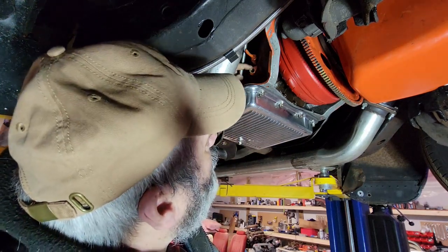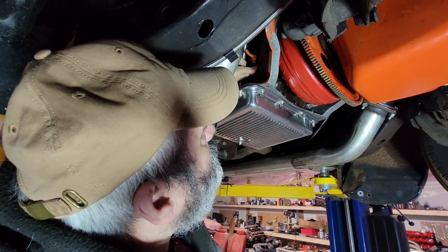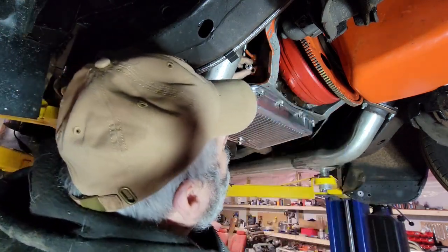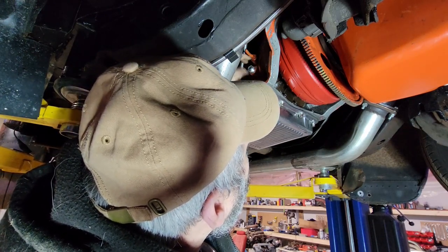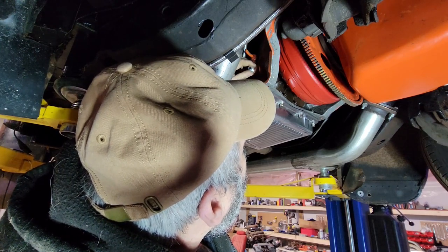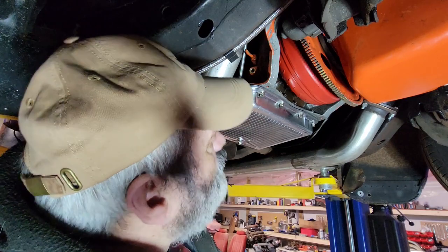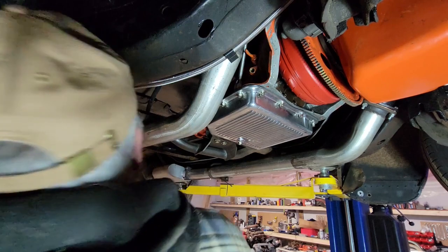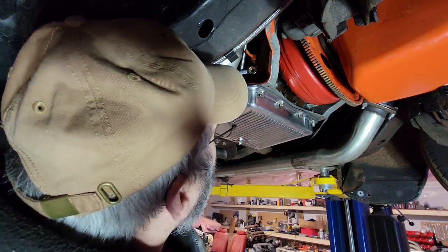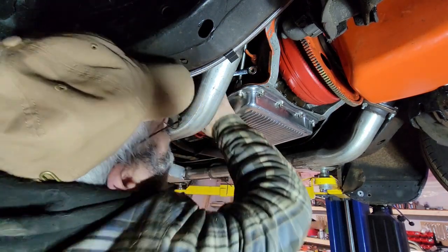You can see there I got the bottom line off. I'm thinking I need to take these out because that's a taper fitting and it won't work. I was hoping I could leave them but they're not gonna screw in there — I need to take these completely out, not just the line part. That sucks; I would have done that when the transmission was out on the table if I'd known. Honestly, I've never used PTFE lines on a transmission before, so this is new territory for me.